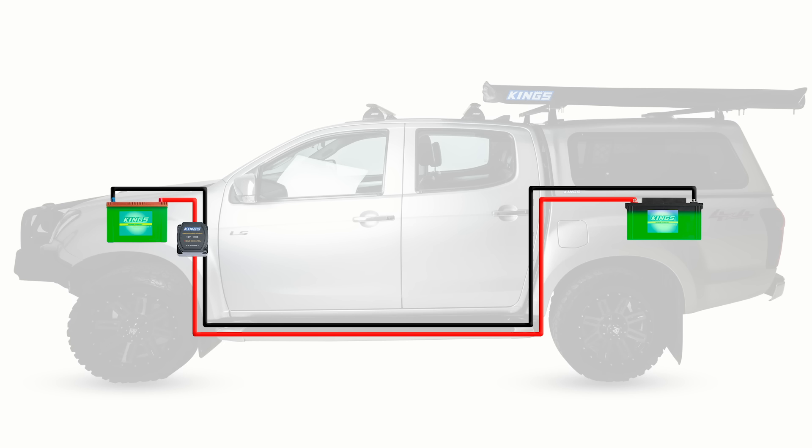The problem is if you're running a battery in the back, it's going to be a very different temperature and will be able to accept a very different charge rate. Smart alternators take it one step further and can adjust voltage and current completely, essentially turning your alternator on and off. When the battery under the bonnet is nearly fully charged, the smart alternator will reduce its output, and when it's fully charged it will stop charging completely. If you're running a smart battery isolator on a smart alternator, it'll disconnect the two batteries and stop charging even while you're driving as soon as the voltage drops below 12.8 volts. It won't reconnect until the alternator kicks back on and it sees higher than 13.3 volts — meaning your fridge and accessories could be draining your auxiliary battery while you're driving without you knowing.